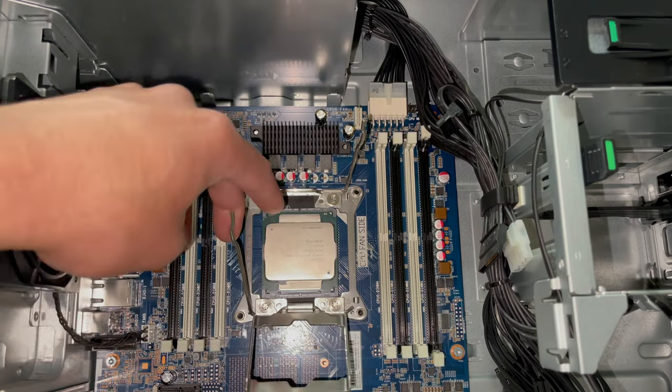I will say, if you're using my reference EFI folder, you should pay attention to the boot flags. Especially if it's a similar configuration to mine, just make sure you're using the appropriate ones, especially if you own a 5700 XT or any newer AMD graphics card. Just make sure you really pay attention to that, as well as your kernel extensions. Make sure the load order is properly set. Make sure you have all of the WhateverGreen and Lilu stuff in the proper order so it loads properly for your graphics card, and make sure you have a supported graphics card. Those are just some advice that I can give.